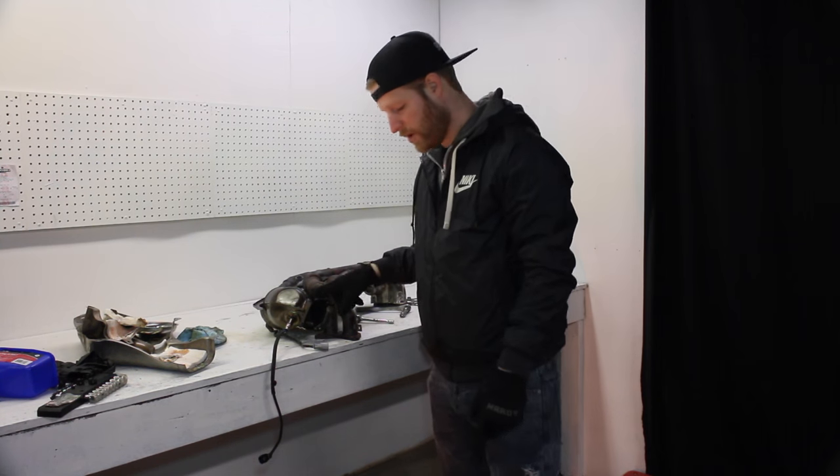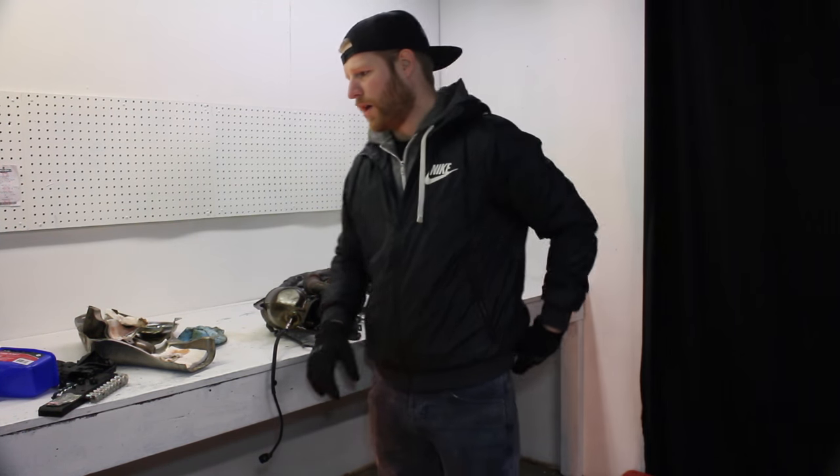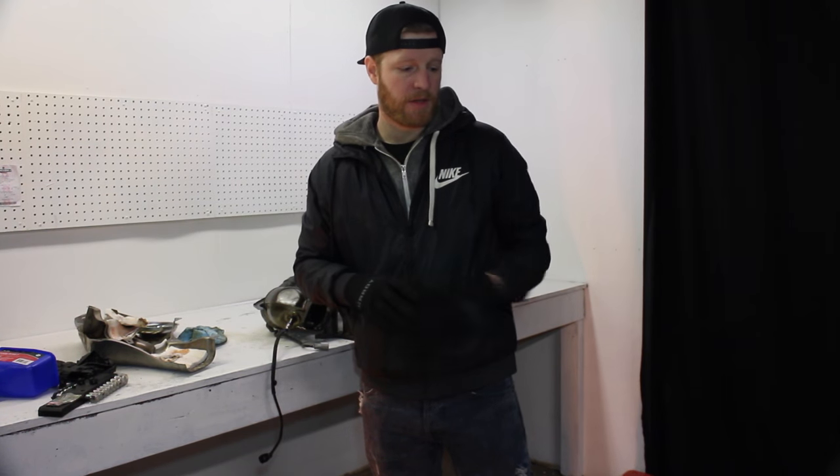I could have easily gone to a Subaru parts website and looked at the exhaust diagram to see how many pieces there are. I found out I'm missing two pieces. There's one piece they call an overpipe - it's a bendy little thing that goes over your subframe and attaches directly to your exhaust manifold. Then you have what they call a front pipe, and that's got your catalytic converter in it. We film at a pretty fast pace here and I don't have time to order parts - I want to get this car on the road as fast as possible.